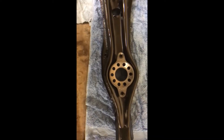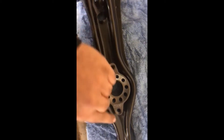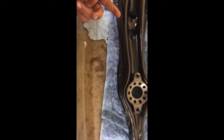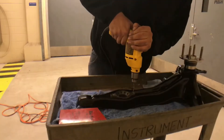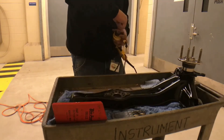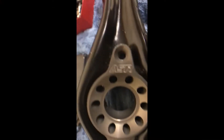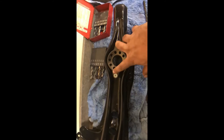Once you have the wheel bearing on and the trailing arm bracket on, I'm going to take a small drill bit and drill a hole in the center of each side, then take a larger bit — I believe it's ten millimeters — until the hole is wide enough for the supplied bolts to fit through. Once you have both holes drilled out, you're going to want to install the two bolts and the two 12mm nuts on the back side and tighten them up.